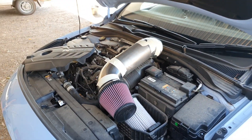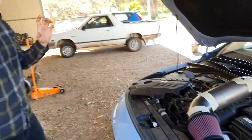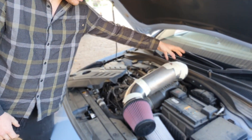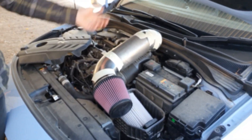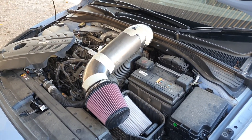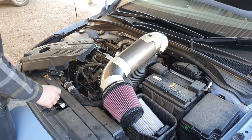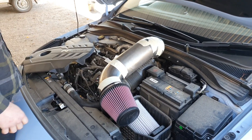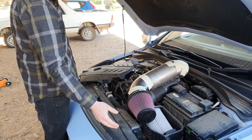That's kind of how it will all sit. I've got to decide: should I run pie cuts there, or get another mandrel bend? I personally reckon pie cuts, because I'm going to heat it and give it the burn finish - because why else do you use titanium? What do you reckon - another mandrel or pie cuts? It will sit nice and flush in there. I'm going to ditch that airbox and I'll have to make mounts for it. It should make the car breathe a bit harder with the size of the intake.